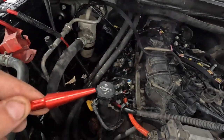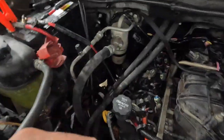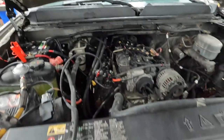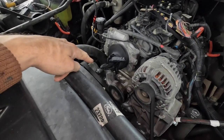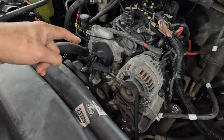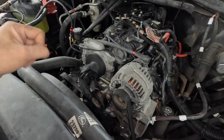All right, smoke's coming out now, so we're going to stick it in there and see what we got. Just one hand. Alright. And now the waiting game begins. See, the glove's starting to expand. It tells me it's building up air pressure in there. And so if there's a place for smoke to get out, you should start to see it here pretty soon. So let's just give it a second.